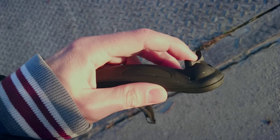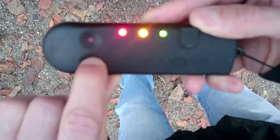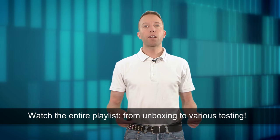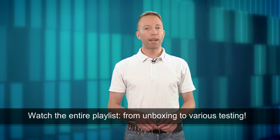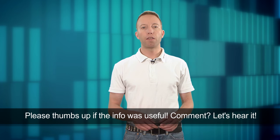The remote still works great after all this time and even after occasional crashes. On my buddy's remote the small trigger lever got stuck, but he tampered with it so that may be the reason. The free play doesn't really decrease over time, which isn't a big problem, though I did notice the remote sometimes freezes when in reverse mode — turning it off and back on solves it. To wrap this all up: after 1500 kilometers we do have some wear and tear, but all is in the normal range. If you've got a weaker board it usually shows right from the beginning; otherwise, performance after 100 charge cycles is constant and still on a really good level.